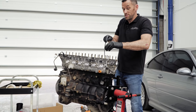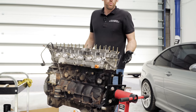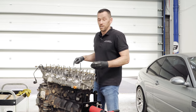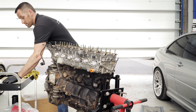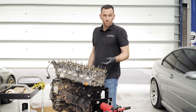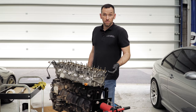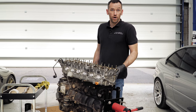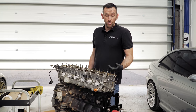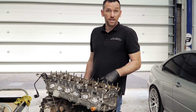So generally speaking, put a set of rod bearings in it, and a new oil pump is a good idea. Yeah, I did the rod bearings pre-crash. So they're okay. I'll do the oil pump. It's worthwhile putting the new oil pump in from BMW because it has a diamond coated oil pressure control plunger in. Really good upgrades for all S50 and S54 engines, the same oil pump. Just a brand new oil pump. It eliminates issues because there is an issue with the oil pump control plunger sticking in the housing. So the diamond-like coating stops that happening.